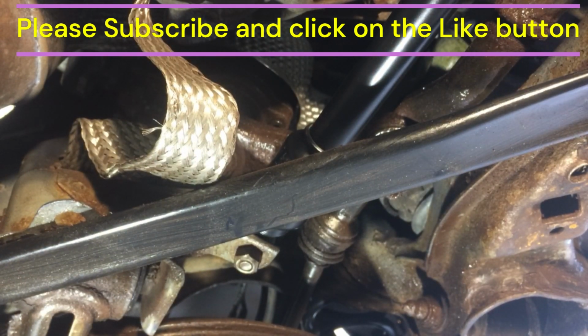This should take care of your sloppy steering. If this does not help, then you need to start looking at other things as well: ball joints, tie rods, your control arms. But for the most part, this is an easy to do repair, and it's cheap. I can't remember how much I paid for it, but you can get these at most auto parts stores, and I'll give you the link below as to where I got mine.